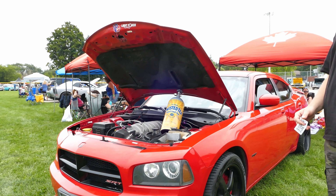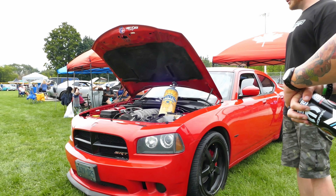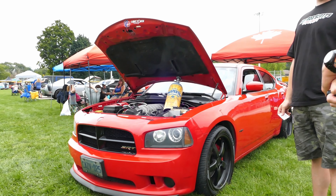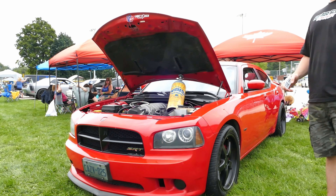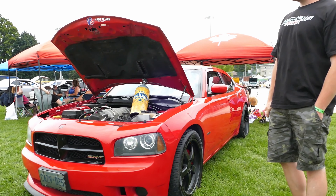At a 150 shot it's like you're cleaning it out or something. So 125 is the safe bet — safe on stock tune. I heard of guys doing 150 and cooking their pistons if it's not tuned properly. And also depending on the fuel you use — I only use pump gas. With pump gas you gotta trust where it comes from.